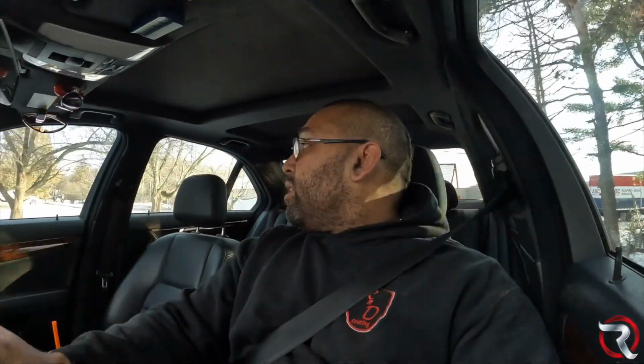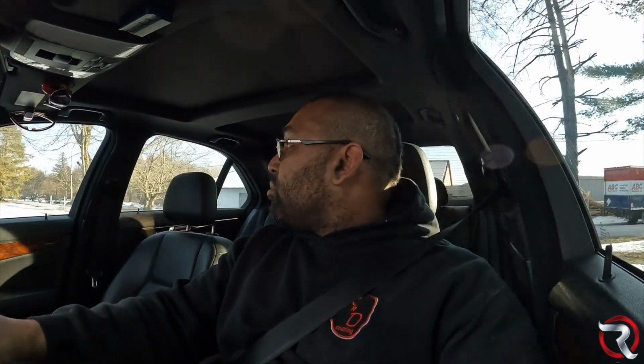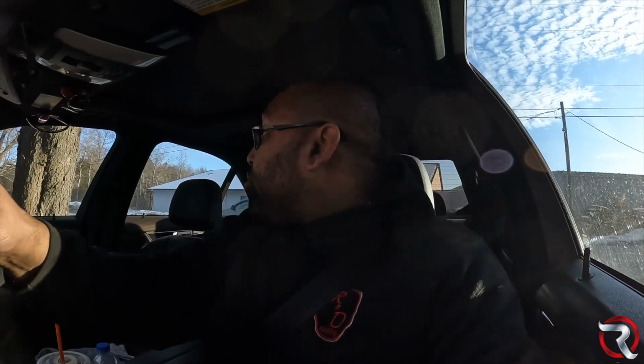All right, people, we're gonna go on our first test drive here. So far so good. I will say one thing: whenever you're all finished up with this, just make sure that you pump the brakes, because your brake pedal's not going to be all the way good since you've been messing around with your brakes. So yeah, let's go.